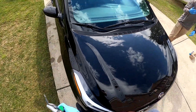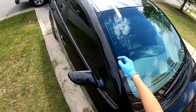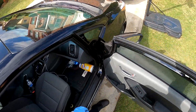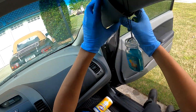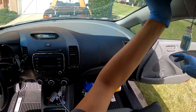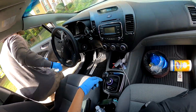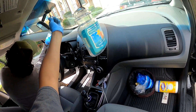Close the hood all the way — you do not want your customer driving down the freeway and have that hood flop and hit the windshield. Peel the tape off; I do not like leaving tape on a vehicle more than 30 minutes. Do not leave the tape for your customer to take off — they will leave it, and if left long enough you run the risk of adhesive residue on the car. Put the A-pillars back on, making sure they're flush with the windshield. You can measure the spacing between the windshield and headliner and check the bead height to confirm you got a good deck.